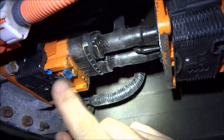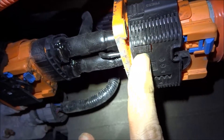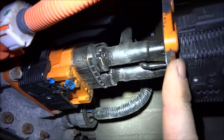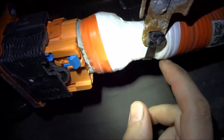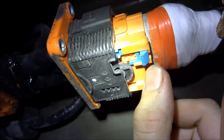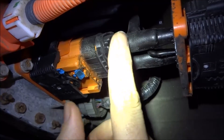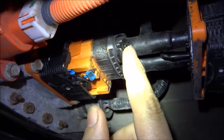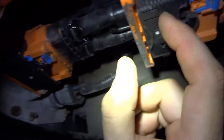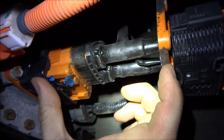This normally connects where this one is connected — you can see they're actually exactly the same. What I did is I purchased off of eBay from a person who had bought a scrapped Leaf for the batteries and was parting off everything else. I bought the cable and the receptacle — the part that goes on the battery. The plug from the car comes in and plugs into the receptacle that I put in. Then the metal bar that normally would go into the battery was cut, spliced, and connected to the plug that I purchased. So essentially it's a very short extension cord.